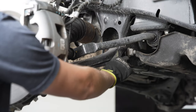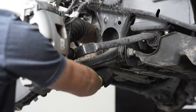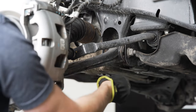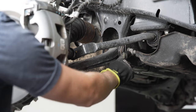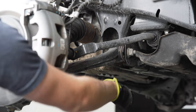To remove the lower control arm from the frame mounts, we need a 27 millimeter socket to loosen the nut, and then a 21 millimeter wrench to hold the bolt on the other side. These nuts are on pretty tight, so you'll want a breaker bar and probably an extension bar on top of that for the leverage you need. Once these are out, we do the same thing on the other mount and it should just drop free from the truck.